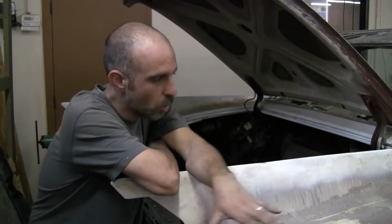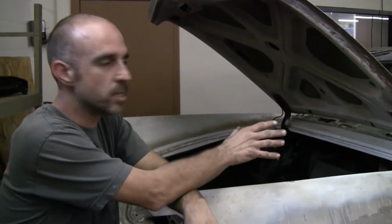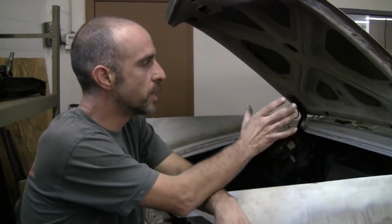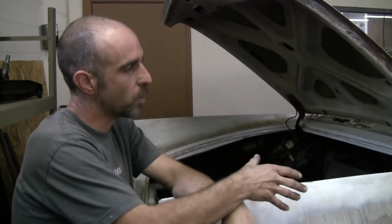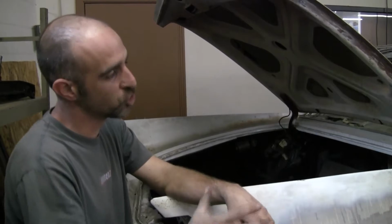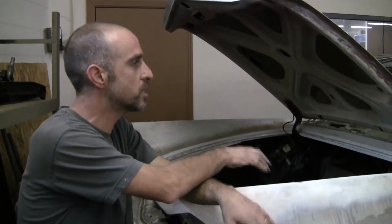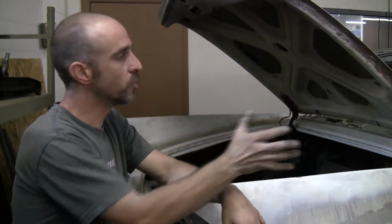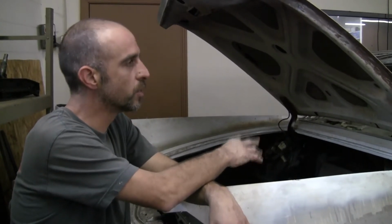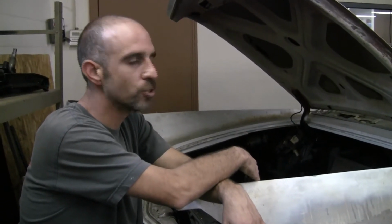We'll have a full roller with all the air suspension and everything, and then from there, the body will come apart in careful and systematic pieces, the rough work done, put back on, interior and the other components will come off also. Everything will be done as sub-assemblies as far as we can, go back on for final fitment, final blocking, and then the whole vehicle will be painted, actually just shy of the dolly. We'll mount it on the car and separate, bag everything up, the engine, the rolling chassis and the body, so that everything is final fitted, then do the final alignment and spray it. And then that's where the electrical, the wiring, the interior, the glass, the trim, the moldings, that would be the last parts that go back on with the car, and we'll go drive.